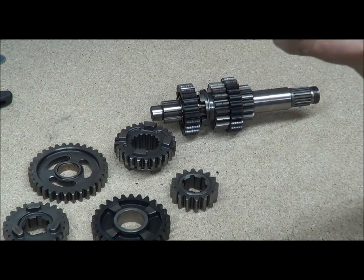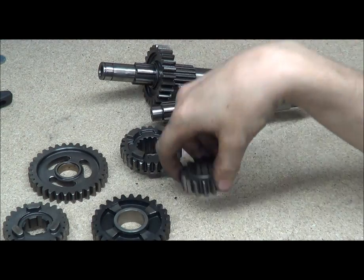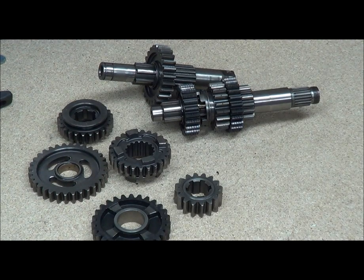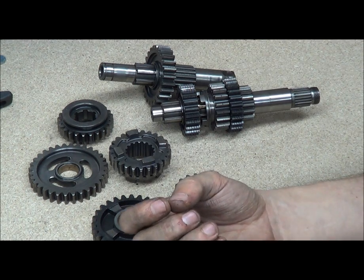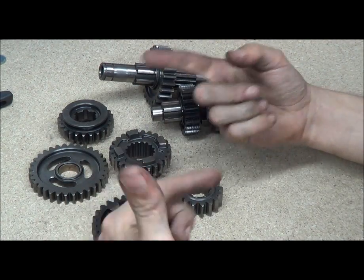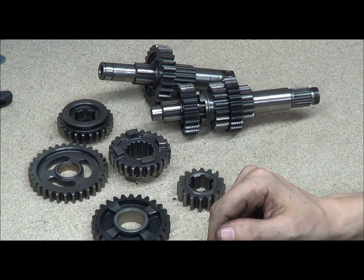If you see wear like that, you should check the dogs and what damage they have on them. You can see the same kind of wear on that edge — again and again, always on one side, obviously the other side being reverse so it doesn't see any action. Do be aware that some of these dogs do break off, and if a dog breaks off it is going to absolutely wreak havoc on your gearbox. You'll also notice some of these gears are stepped — they have a little stepping. This is to aid in engagement. They'll do a follow-up on the design, test a ten-year-old bike, find that third and fourth are a bit edgy in transition, then pull it apart, put it in a clear Perspex case with bearings, speed it up and change gears on a test bed, and tweak it — like taking that edge off because it's just a bit too aggressive.